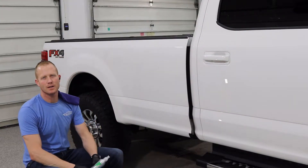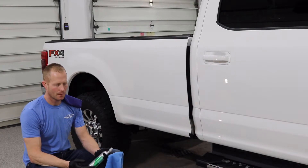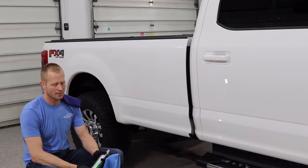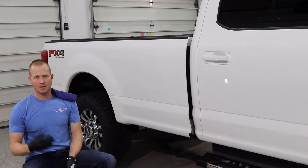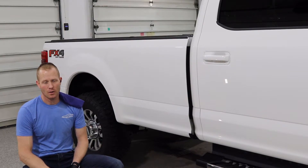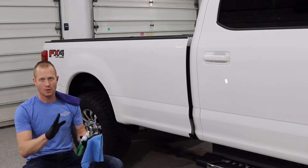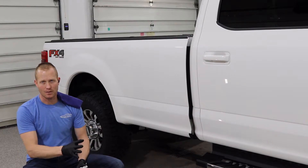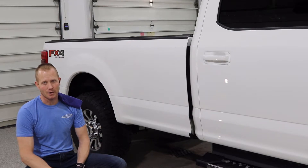The application of CanCoat here is much easier than a typical coating. The solvents evaporate quite quickly but leave behind a thin layer of very durable protection. One nice thing: if you do the whole vehicle and think you got everything, pull it outside even an hour later — if you find a high spot, which will look like a streak or smear, within an hour or maybe even two or three you can re-apply CanCoat to your cloth and the wet product will even out any streaks left behind. Then just hit it with your leveling cloth again and you'll be good as new. If you leave it a couple days you'll need to break out a polisher to get it off.